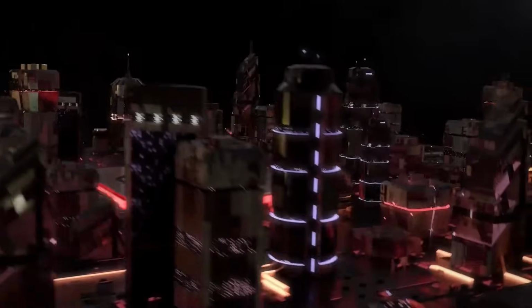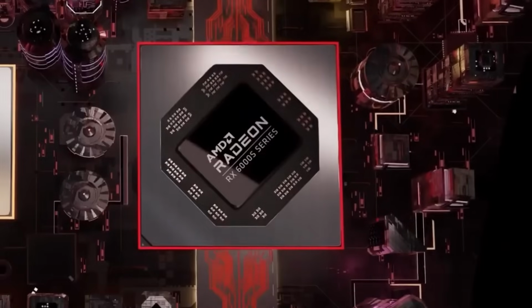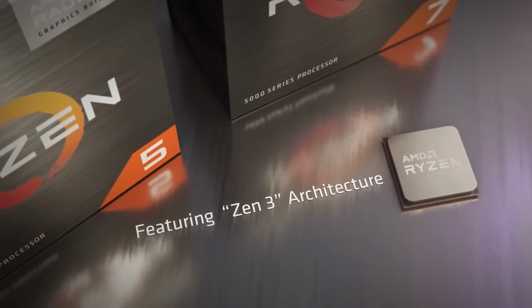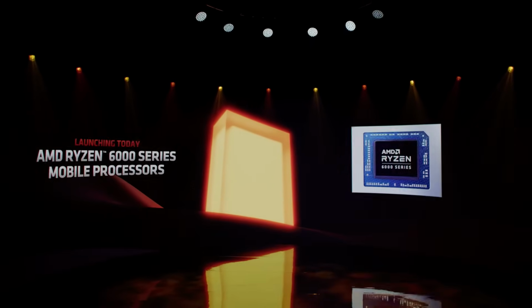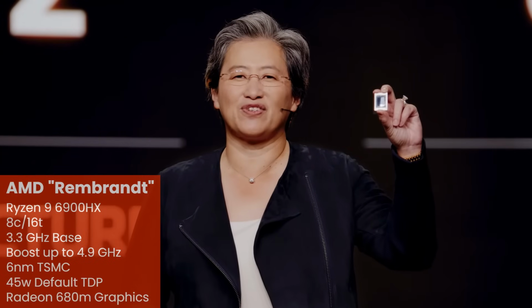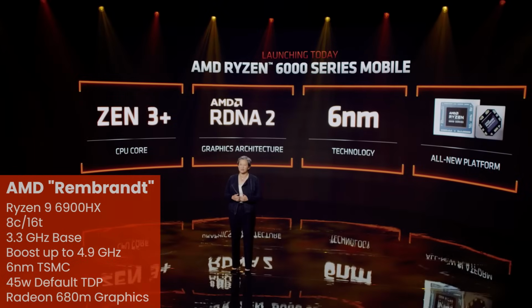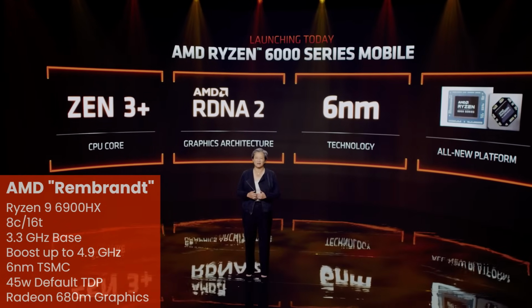Before we dive into the specific specs of this mini PC, let's talk a little bit about the Ryzen 9 6900HX. This processor was primarily designed to be used for gaming laptops, and so it's a pretty substantial APU based on the AMD Rembrandt generation with 8 Zen 3 Plus cores and 16 threads clocked at a guaranteed base of 3.3 GHz with a boost up to 4.9 GHz and is manufactured on the Taiwan Semiconductor 6nm fab.